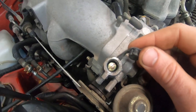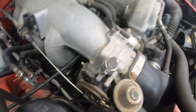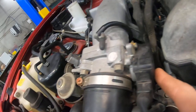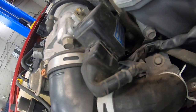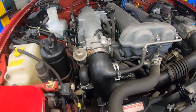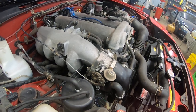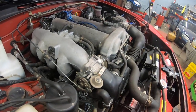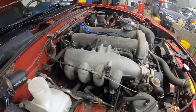This little guy here is for adjusting your idle speed — just a flat head screw with a dust cover over it. On this side of the throttle body is your throttle position sensor. It's kind of interesting to look back at this early 90s tech — it's a fairly large sensor that actually only has three positions. It doesn't tell you how far it's open; it only knows idle, wide open throttle, and somewhere in between. It's a pretty basic sensor, like a lot of things on these early Miatas.